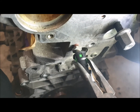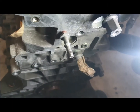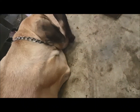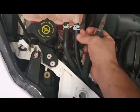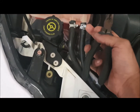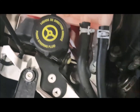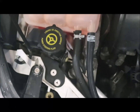Push it forward, squeeze the two tabs in, give it a bit of a wiggle, and off she pops. To fit the new one, literally just switch it in. Ignore the cracking sounds — that's our workshop dog annihilating a block of wood. Now we've got the new hose in there, clipped in all the way along. For the spring clamp, they superglue it, so you can just lift that tang off. I don't like to use my fingers because I've caught them a few times. Grab that tang, give it a lift — there you go. You can move it all the way around or just leave it like that. Perfect.